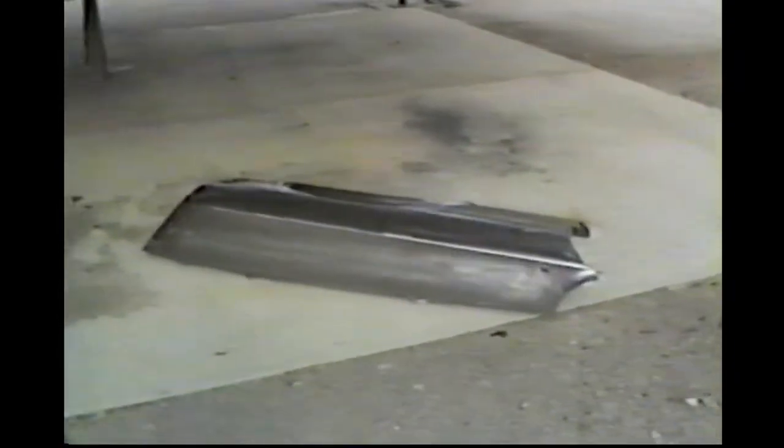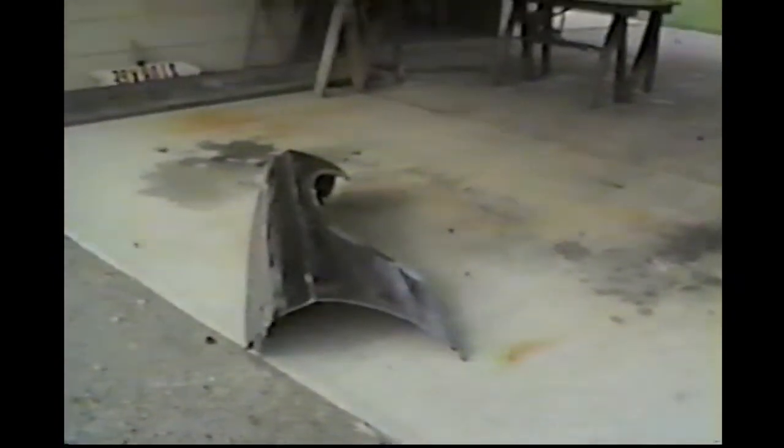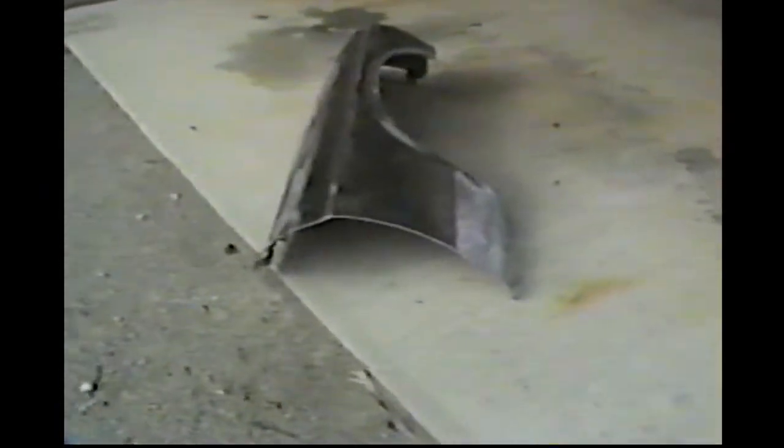Get the idea. It's kind of where it all starts, right here. Now we put a self-etching primer on that, which grabs a hold of the steel, which is real important. And then after that, we put on the polyester type filler, called Ultrafill 2, and you get an idea how it all starts. One piece done, we got the whole rest of the car to go.